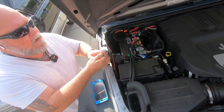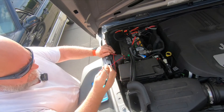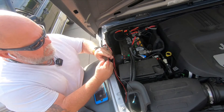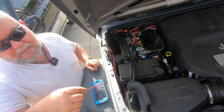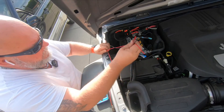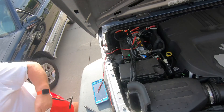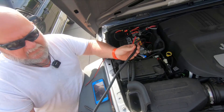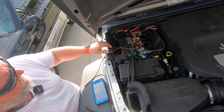We have our positive and our negative coming from our USB ports. We're going to get these ready to go in here. I've got the inline fuse for that — it's a good sealed one so we don't have to worry about it getting messed up. It says 10 amp max, so that's what's in it — 10 amp, we're good there. I do have some plastic loom to dress it up. I picked this stuff up at Lowe's — bought one pack a while back just to have on hand for stuff like this.